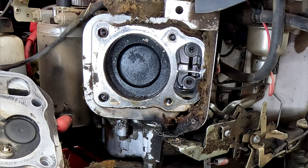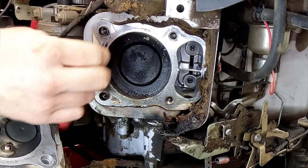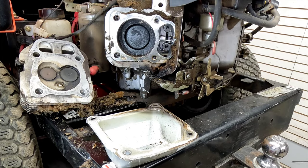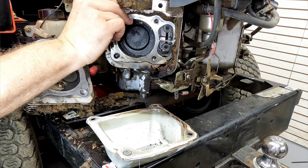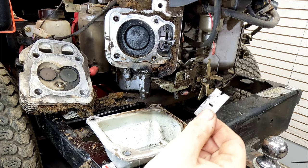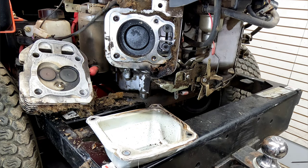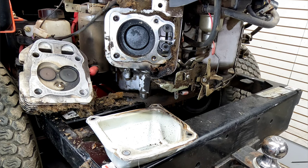Let's show you just how nicely this razor blade works. You can get all around without taking any of this stuff out, without getting everything scratched up. As soon as you start scratching, get a new razor blade. That is my go-to method for any kind of gasket removal — a razor blade. I don't think there's anything out there that touches it in most cases. In this next case, it's kind of hard to get a razor blade in there, so the other method we use takes the cake.